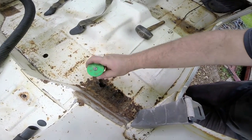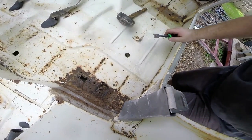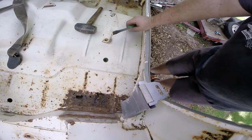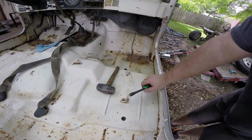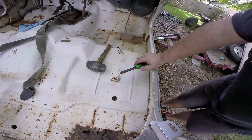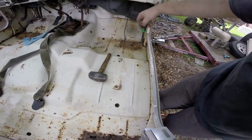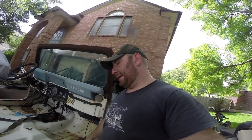This was the worst area right here. You can see the top of this tub kind of gave way in a bunch of places. The way you test this is you take a cold punch chisel and go around and smack it. If it just comes off as surface scale rust, you can tell it's solid. But this is just punctured - there was nothing really to it. You can get entire replacement tub pieces - even a whole replacement tub - or floor panels in 18 gauge with the ridges already creased in. The whole tub is like four separate pieces and we'll probably end up buying three or four of them. Or you can just buy a 4x8 sheet of 18-gauge steel and do all the patchwork yourself.